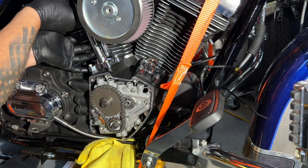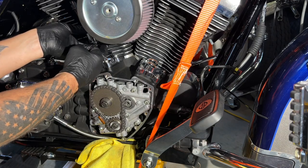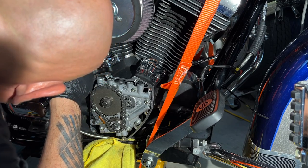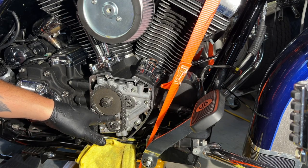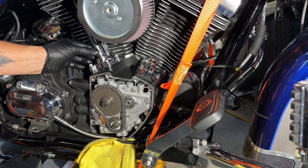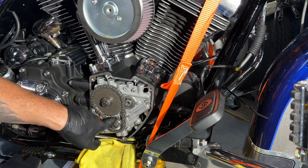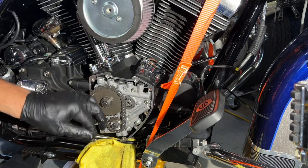Now I'm going to take it and start turning until I touch the bottom of the tappet. I'll hold the top of the rocker and turn counterclockwise. The exhausts are usually longer than the intakes so this one takes a bit longer. See how it's barely moving now — I push it up against the top rocker and keep turning. There it is: I barely hit the top rocker and you've got zero lash. I'm going to rock it until it stops — when it stops, that's zero lash.